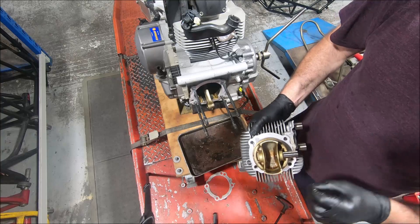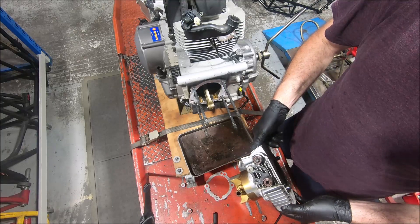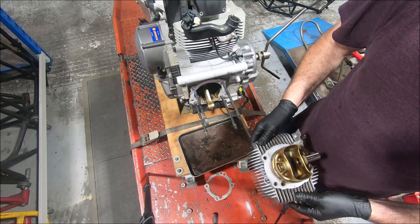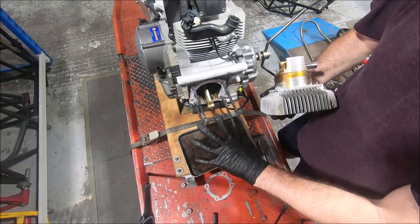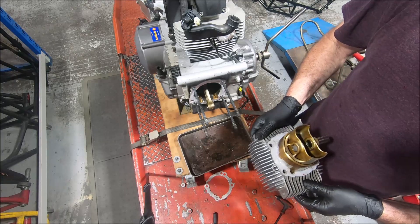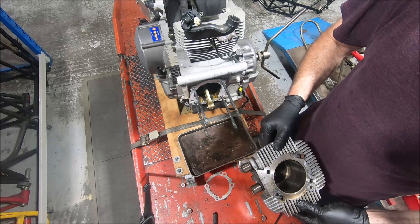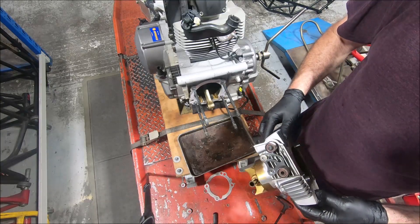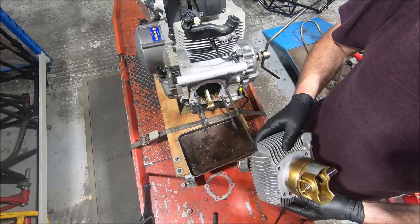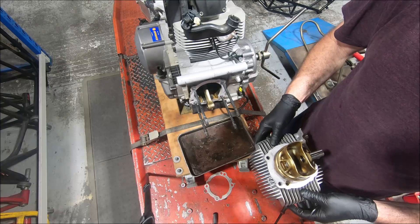So that's interesting. I was hopeful that we might be able to use these cylinders and heads on the earlier engines, but we can't. And we can't really use them on a 900 because of the bore limitations. The 1000cc stuff uses the bigger 996 stud spacing, so you can't use 1000 parts on a 900. You could bore the cylinders out and put some liners in them - even aluminium liners and get them nicosilled - or use cast iron liners, though I dislike cast iron liners. They're not as long-term usable as a nicosilled bore.